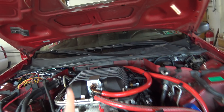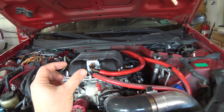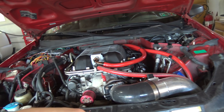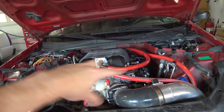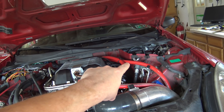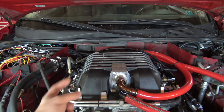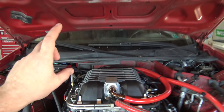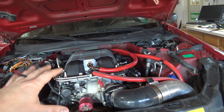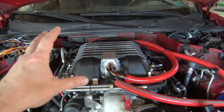It's a returnless system — it has an internal feed into a plastic regulator in the hat that diverts the excess. It also has a built-in venturi pump that pumps from the saddle tank on one side back into the other side, creating suction to pull fuel from the saddle tank over. All of that seems to be a bit of a restriction, even though LoJ has made modifications.